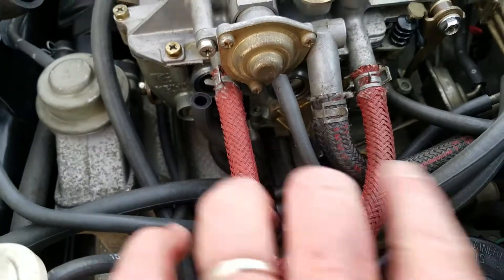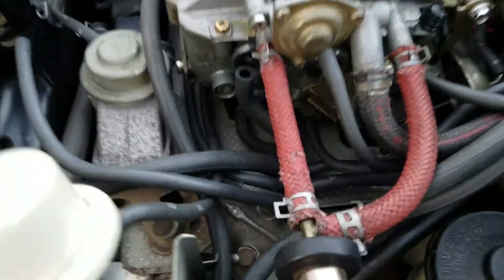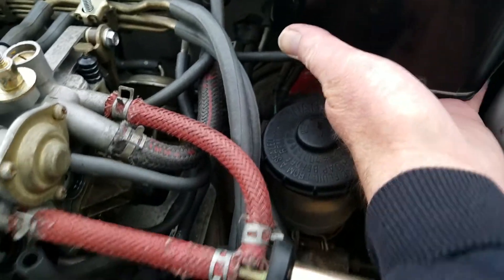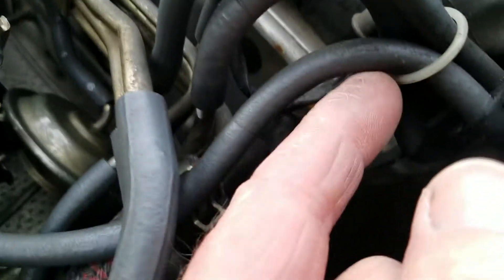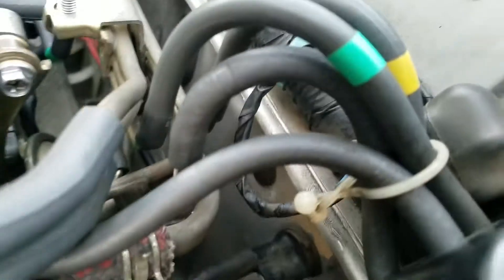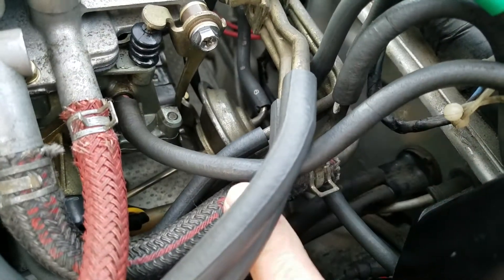These two are your fuel lines — should go into a fuel filter, which you want to replace if you took off the carb. Then we have this vacuum box — there's one that's below it and that connects very obviously right there into that gang. Coming out of here, the inner one comes down right under those hoses and connects here on this copper pipe. You want it to go underneath — if you put that on top, once you put the air filter on it'll crush and pinch that hose, so make sure it goes down in between these two.